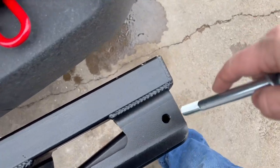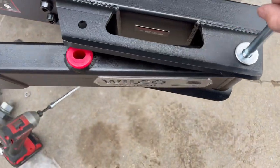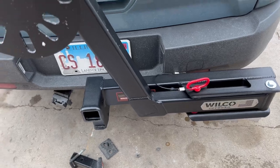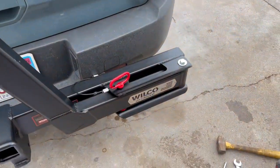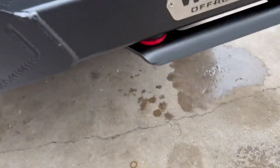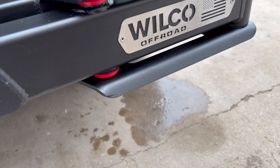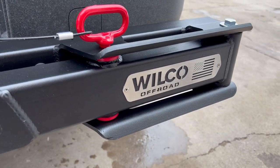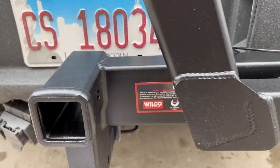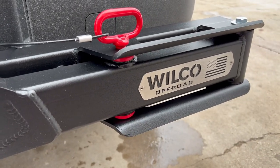Aside from moving the camera around, as you can see it's going to be a tight fit. Just like that, we have the hitch installed — pins in there, bolts in there. Don't over-tighten it because if you over-tighten it, it will not move at all. Use that at your discretion as far as torque specs — the instructions don't really say how much torque. We're going to get everything all finished up, put back together, and go get our wheel put on.